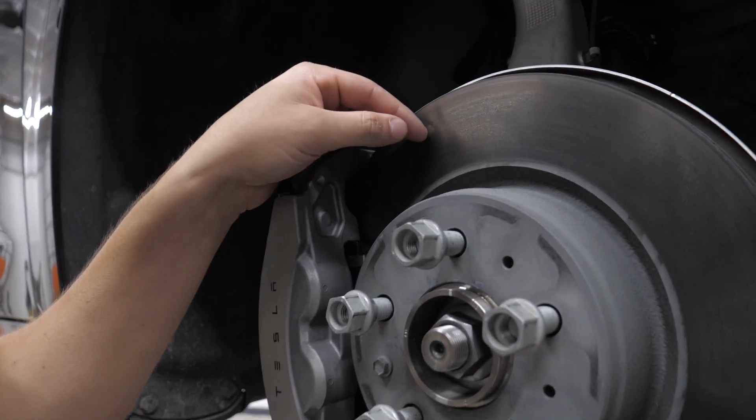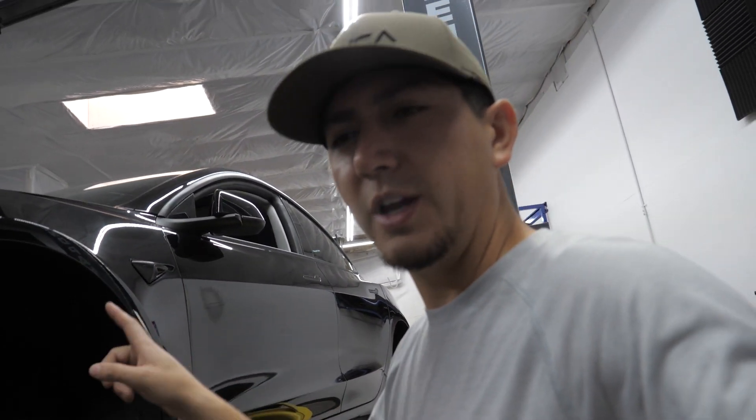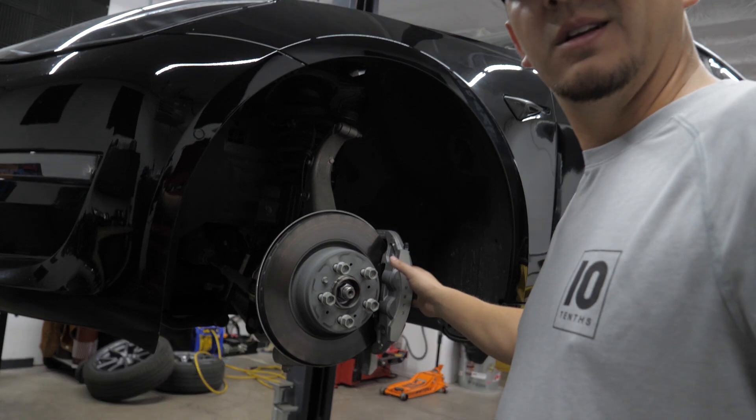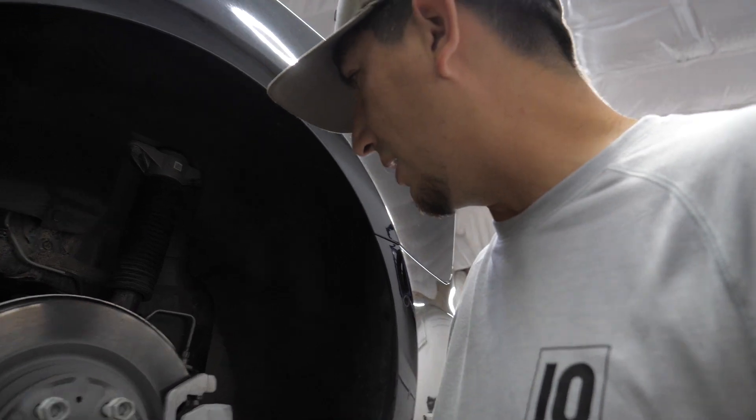And if we go over here, it's magic — not a single groove on these brakes at all. I actually don't know how many miles are on this car, but it would be like maybe less than 200 or 300 if this was a normal car. For those of you who don't know, just about every three-phase AC electric car has regenerative braking. This Tesla has regenerative braking and it's extremely strong — you can have it on full or reduced. When you have it on full regenerative braking, single-foot driving is totally possible, so really using the brakes like these bad boys here is kind of a thing of the past. There's not a single bit of wear on these brake pads.